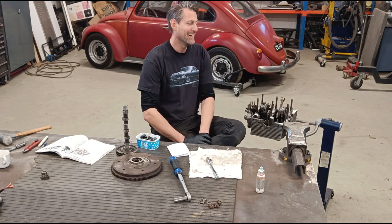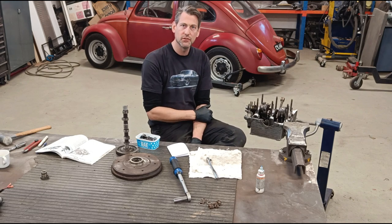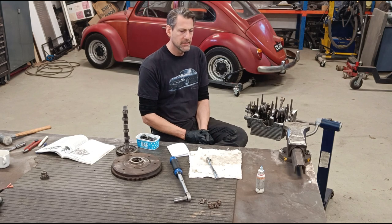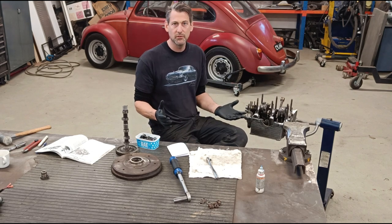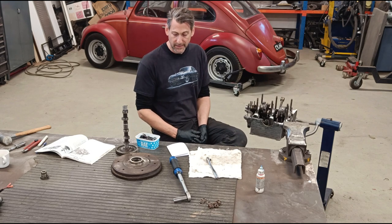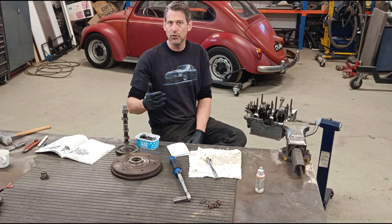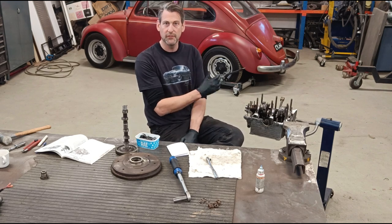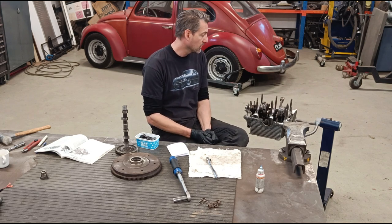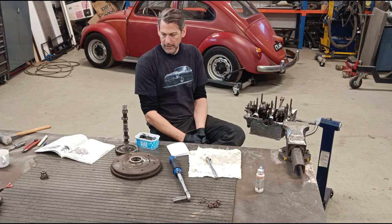Well, positive things, obviously. And there was also a helpful remark somebody made about the distributor, the 123 ignition distributor that I'm running on there. They said that they had noticed that I had a vacuum advance distributor. I did actually yesterday block it off to see if it made any difference, but it didn't seem to make any difference. The car's running really well now, no popping or banging. And also with the vacuum advance, I believe it works mainly on the lower rev range, so general driving it shouldn't make too much of a difference. I knew when I ordered it that it had the vacuum advance and I wouldn't be using it. It's just that I thought that if it goes in another car, it will be suitable for everything and would last me a long time. So it hasn't seemed to have made much of a difference, but yeah, it was nice to have a helpful comment.